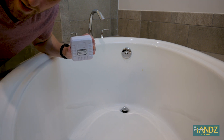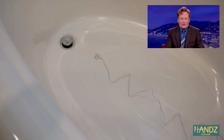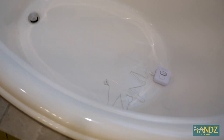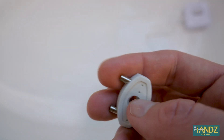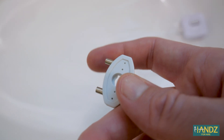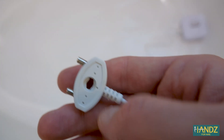We're going to try the same alarm with the wire sensor attached now. The way this works is they've got two little terminals and it's an open circuit. Once water gets involved, water is a conductive solution — it actually transfers electrons from one side to the other, and that completes the circuit and sets off the alarm.